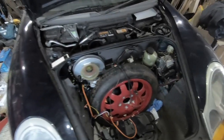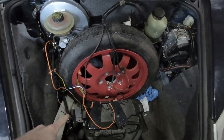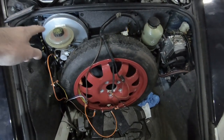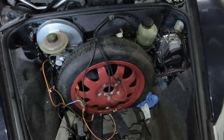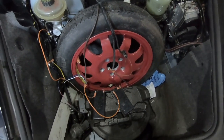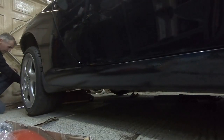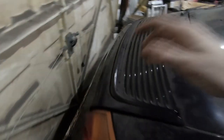We're ready for our next short test drive. We've got our auxiliary systems in place — brake vacuum down here with our new master cylinder and brake booster, which is all good, and we've got our power steering here. I'm using two separate batteries at the moment and don't have any switches for these things — it's literally just plug and play. So I'll plug them in, close the hood, and then get the car going. We're going to get the battery hooked up to the inverter, then switch on the inverter and associated parts, then switch on the brake booster and power steering, and then try and get the car out.